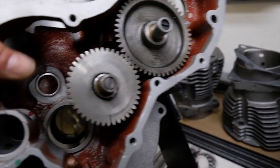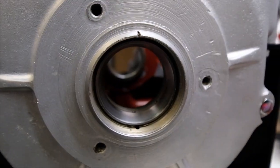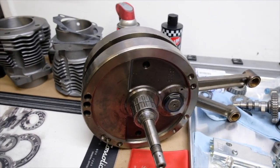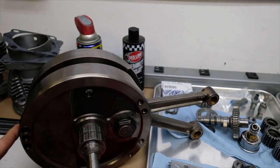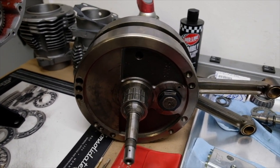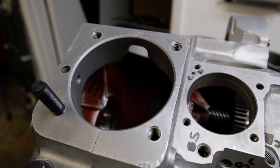Aside from that, I had installed the needle bearing for the camshaft the other day - that came out before blasting. I also installed the tapered rollers on the primary side, so those are all pressed in. This thing is gonna be ready to receive the crankshaft real soon. The engine had been recently built, and in the receipts there were receipts for the crank getting balanced and trued, so I'm going to assume they did a good job there and not send it out for rebalancing.